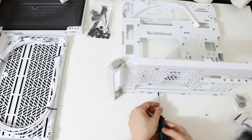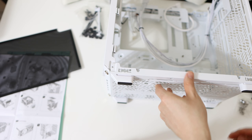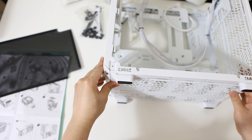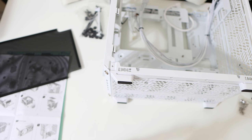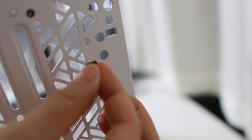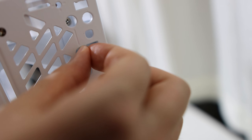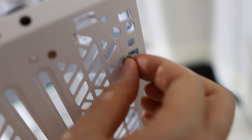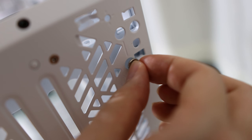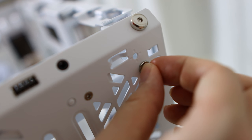One precaution I have is when securing the PSU bracket — assuming you are mounting it at the front — is to use the regular screws and don't use the single screw that says 'PSU secure bracket' on the manual. That screw is actually optional, and if you use it, you will need to remove the front structural panel because the screw head is too large and won't go through the hole on the panel. So use the regular A screws.